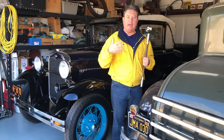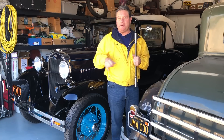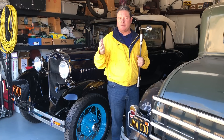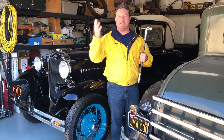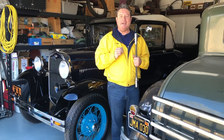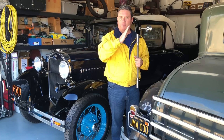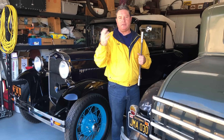Sometimes wear and tear, a bent frame, motor mounts sagging — lots of things can cause that to be thrown off. So the geometry of the Ford Model A is a very precise thing, believe it or not, and when Ford made these brand new, when they rolled out of the factory, everything was perfect. Fast forward 90-some odd years into the future and now they're a little less perfect. So sometimes the steering box might be off one side or the other of that perfect center when the car is going straight, and if so, you're going to have a little bit of play in the steering that you'll never be able to get out.